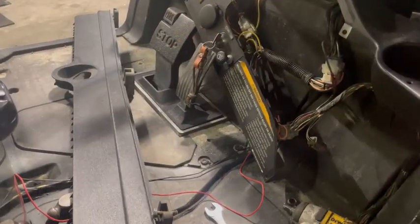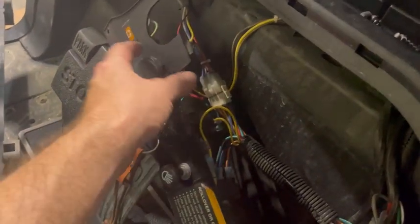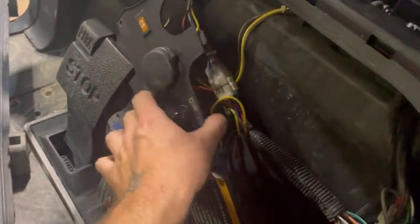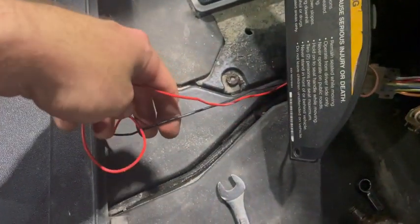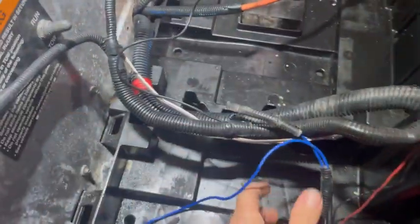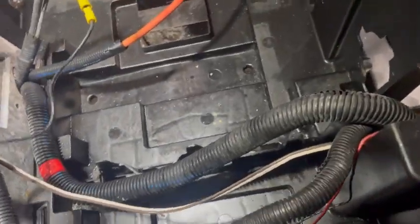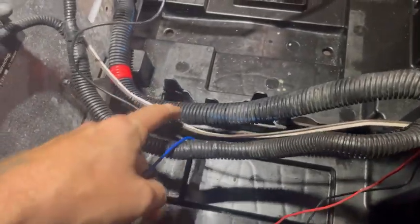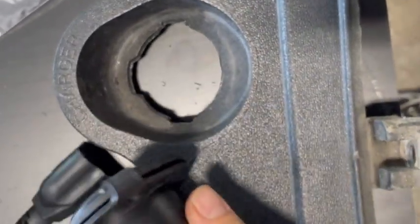Remove that and toss out your receptacle — you're not going to need it again. The Bolt has an AC receptacle that we'll be installing. When doing these conversions, be mindful of any accessories the cart might have. This one has a USB port that is 12-volt operated, so it has a main positive and negative that are going to go to the new Bolt voltage reducer. There's also a light kit, so you'll be attaching your light kit's positive and negative. Next, we're going to install the charger receptacle port.